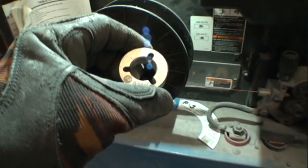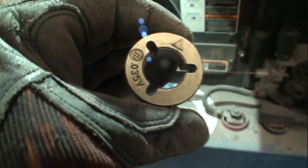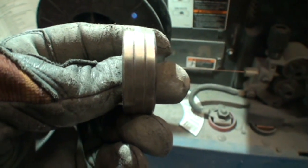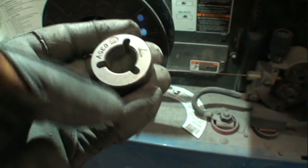I've made several videos on welding settings and such, but this is basically about the wire. It's the wire we're talking about here. I'm watching your videos and I'm seeing you weld and I'm noticing the wire you're using is not .023. If you are doing automotive, hobby shop, or DIY work, .023 wire is the way to go. And if you have a half-decent welder, the rollers — you can see this says .030, and when I turn it over it says .035. This set of wheels is for the very heavy stuff.